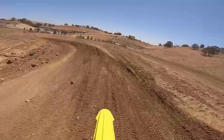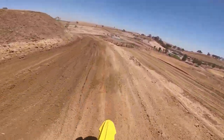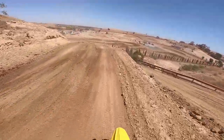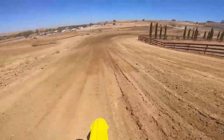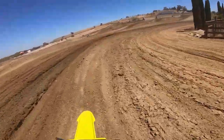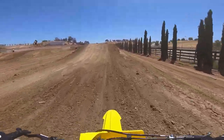Alright, I got it to rattle a little more under load. Out of the box, it is just a little hair lean. That could also be because of the fuel I'm running. If you guys are running pump gas, it might not be a problem.